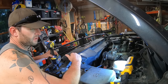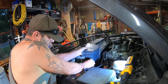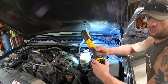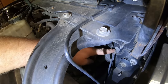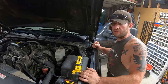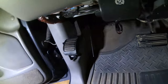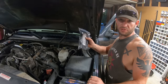So I'm going to go ahead and get the switch installed. First thing I need to do is remove the ECM. Now it says locate the hood release grommet in the firewall — there it is right there. Pull the grommet out, stick in your feeder wire, and find it under the dash. I love fish tape wire for stuff like this — it works so great. There it is next to the parking brake that doesn't work. I'm going to use the guide wire to pull through the five-position switch wire.